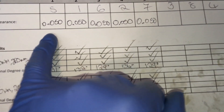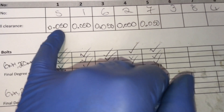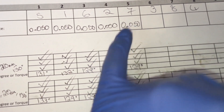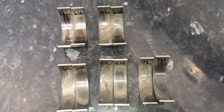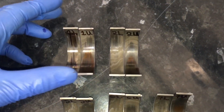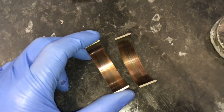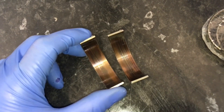I'm now on cylinder number three and I've been putting ACL bearings in. All the bearing clearances of the ACLs are 0.050mm which is great — it's what we'd expect and what we want. Here are the rest of them; some fairly worn ones, especially cylinder number one upper. But yeah, this takes the biscuit — cylinder number three was very, very close to spinning, I'd say.